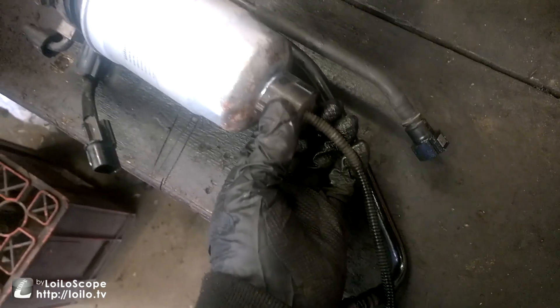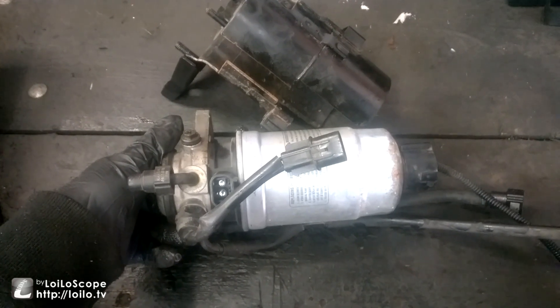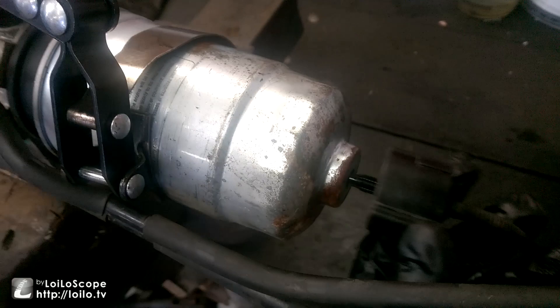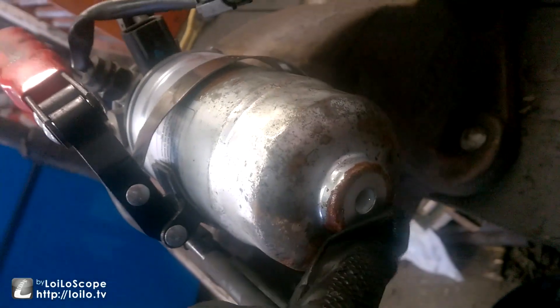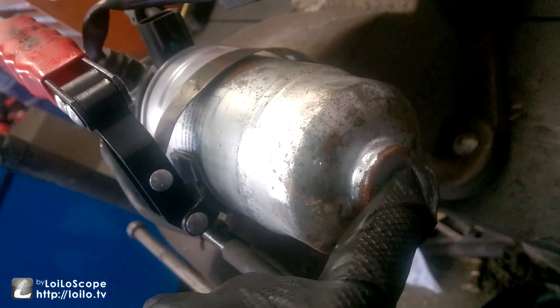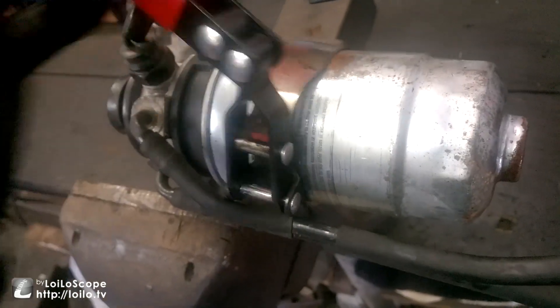Put it in the vice now and remove the fuel filter by turning it anti-clockwise, and disconnect this bottom piece as well. There are two different types of fuel filters in most of these — the difference is in the bottom and the size of the hole that's down there. I'm just using this strap to remove it.